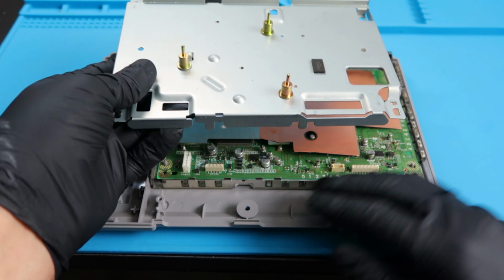So I'm going to go ahead and tape this down with some Kapton tape once I have everything lined up the way I need to. I'm going to go ahead and take a little bit of solder. I already have the flux on the parts I'm going to solder right now. So I'm going to go ahead and just solder this point here. And it's kind of cool because I've never soldered anything this small before. So I actually feel like I learned a lot from this particular experience here. Had to learn how to have a steady hand.